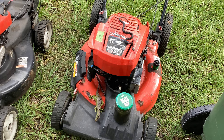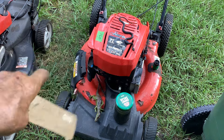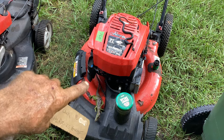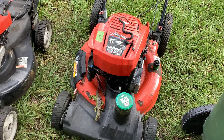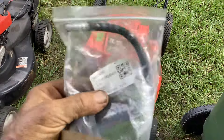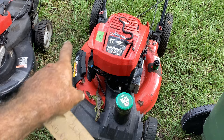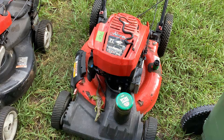Welcome back. I'm working diligently on this Troy-Bilt that came back from a customer who had bought it last weekend. He said it was running terribly, would stall, and he couldn't get it running. Chuck — shout out to Dirty Bernie's Garage — commented on this morning's video and said why don't you try the carb, because if the rubber and the needle is swollen it's only going to drip, drip, drip into the bowl.